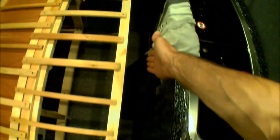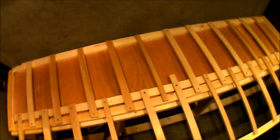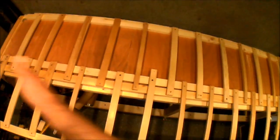I just need to get some legs ready for when it's in the pulled-out position. That's where it'll come out to, and I should still be able to shuffle in between the bed and the unit, just in case you need to make a cuppa while the bed's out — it should still be possible to stand next to the sink and the hob. Timber-wise, it's probably only cost me about £20–£25 at most. Thankfully the slats were spare anyway. On my previous bed I made the slats from pallets, which you can easily get for free. Making a bed like this doesn't cost much at all. You could use reclaimed timber for all of it, but with everything else in the van being new I thought I'd use new wood. That is the basics of the pull-out bed — done.